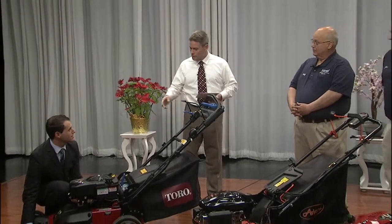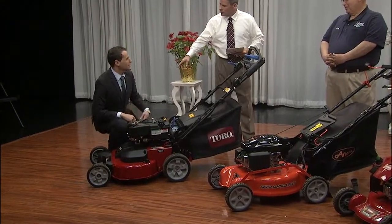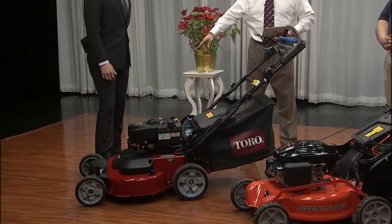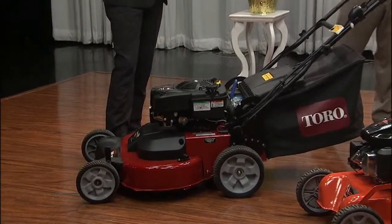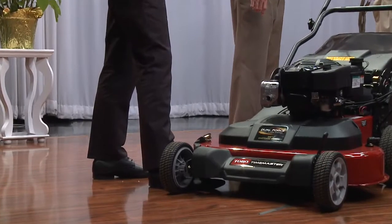Can we start off? I just need to ask, as we do this, are there any do's and don'ts? Like, we have Sam's foot under the mower — this is one of those don'ts. Don't put your foot under the mower no matter what. Even while it's not running, because a blade can spin, especially if it's been jammed.